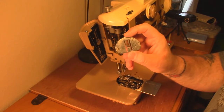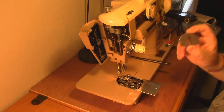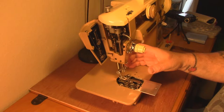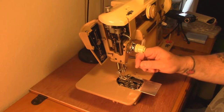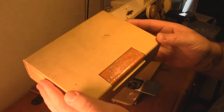Broken needles are generally a result of deflection, so if we can keep it clean and keep it rolling, we won't deflect. Once you get this apart and you're looking around inside, something to think about: if you take it apart, try and remember how it goes back together, because there's nothing less fun than trying to piece back together a sewing machine that you just took apart to clean.